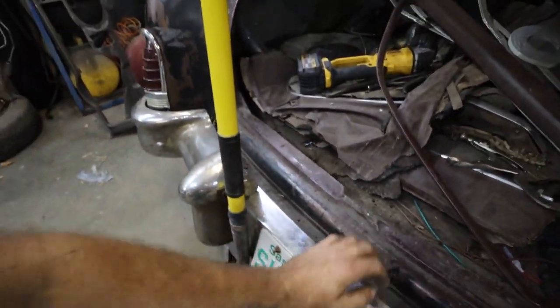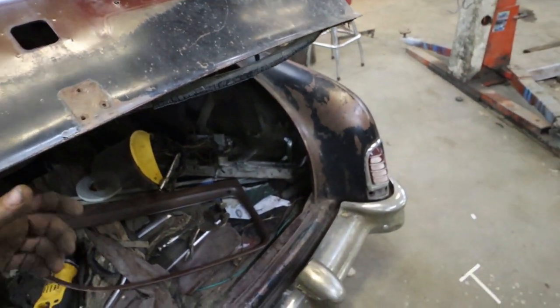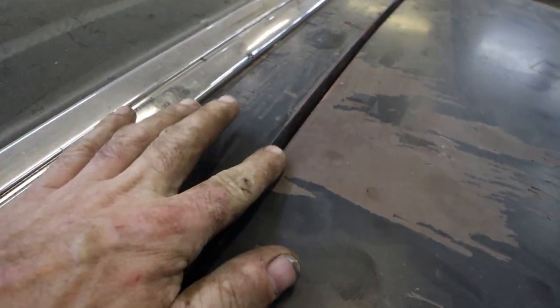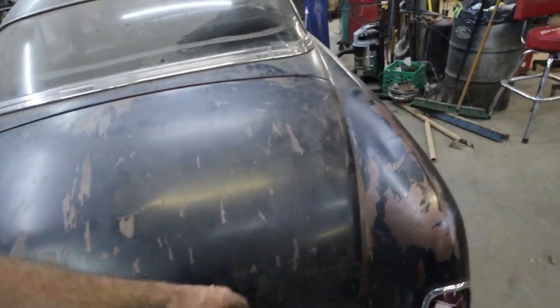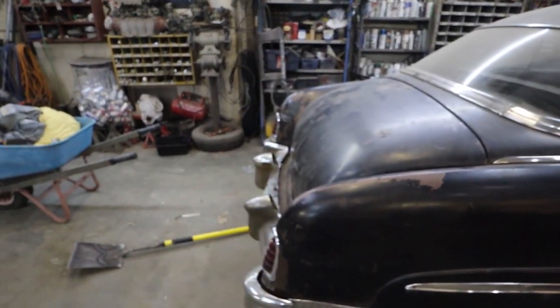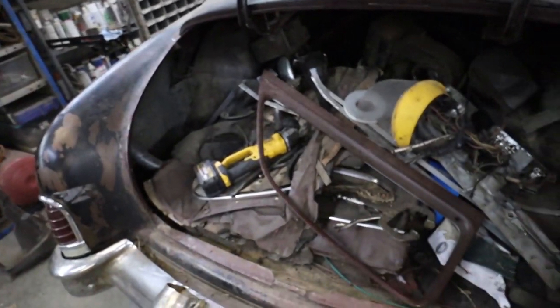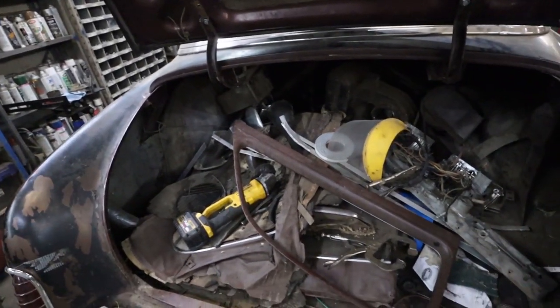I have zero latching system, so I'll have to figure that out. But when she's closed, she's all good. The gap is a little big, but you can see it's a little bit low. But if we shim the hinges, it's probably going to be fine. We don't have any spring or strut system, but I can easily just do like the front hood and have a prop rod in the trunk there. It's not very heavy. And once it's up, you kind of just throw a rod down, hold her up. I mean, I don't know how often I'm in there, but